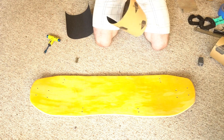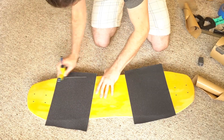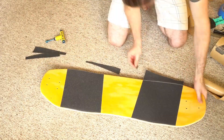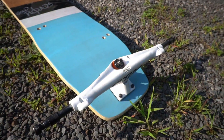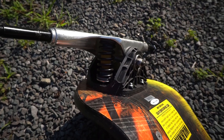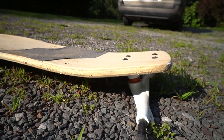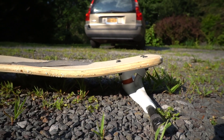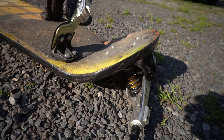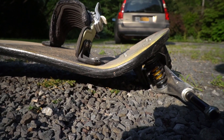The deck came out great. This time around, I got all the curves and shapes exactly the way I designed them. Something I find irritating about the mountain board industry is how non-standardized everything is. One of the biggest offenders is that the two main styles of trucks — the skate-style trucks and what we'll call the matrix-style trucks — require different nose and tail angles to work properly. The skate-style truck is basically a low-angle traditional kingpin truck, so it requires less of a nose and tail angle to get its working tilt. The channel-style trucks are effectively a zero-degree truck, so the angle in the nose and tail is what gives the truck its ability to turn.